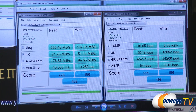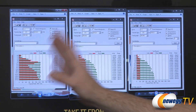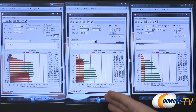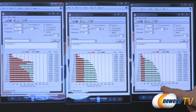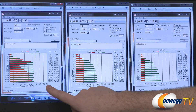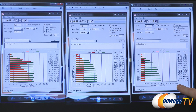Finally, we have ATTO, which is kind of the old standby — it's been around for a while and is used widely in both hard drive and SSD testing. The left side test is the default with no SSD cache drive attached. The one in the middle is the test with the Adrenaline SSD attached connected to SATA Revision 2, 3 gigabit per second bus. On the right we have the cache drive running on SATA Revision 3, 6 gigabit per second bus. Bear in mind the charts scale based on the data represented — this chart goes up to 200 megabytes per second, this one to 500, and this one to 1,000 megabytes per second.